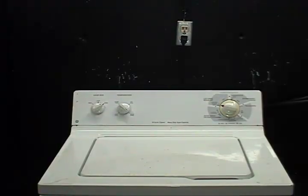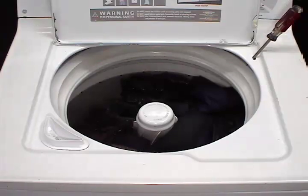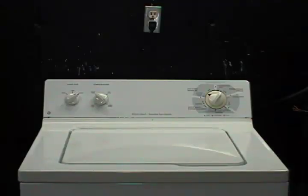To be able to run the washer with the door open to check the spin, you will need to bypass the lid switch. If your washer has a lid switch like these, all you need is a screwdriver to activate it. Let me show you how to bypass the lid switch so you can run the washer with the door open for checking the spin and the agitation. Bypassing the lid switch should only be done for testing purposes only.